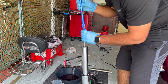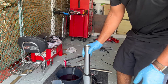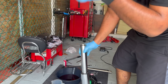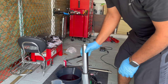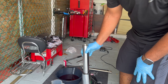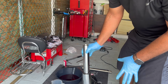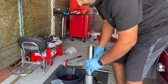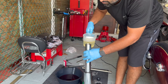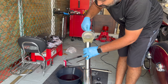Now you can unscrew the damper rod holder. The 350 milliliters was just an initial quantity to bleed the forks. The final spec for the Springfield, Chieftain, and Roadmaster is 557 milliliters per fork. I've already added 350ml, so what I like to do is top it up more — fill it all the way, as much as you can — because we're going to take out the excess in a bit.